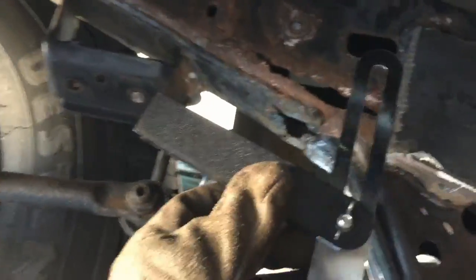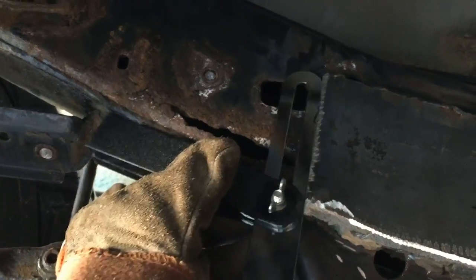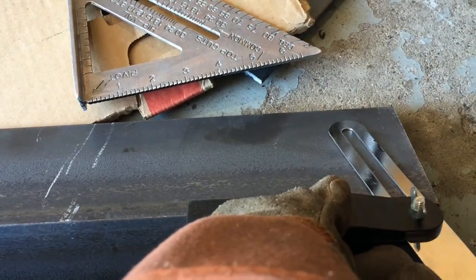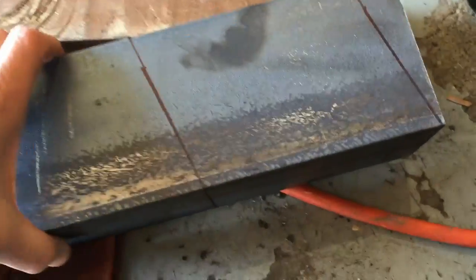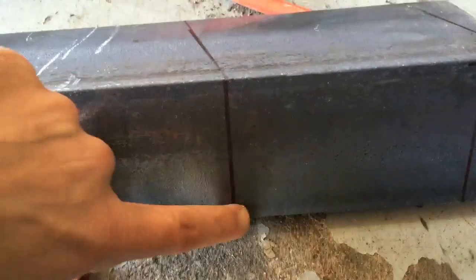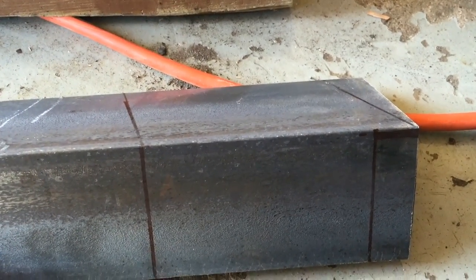Here's a handy little tool that helps me determine the angle. With a little bit of measuring, we ended up with 30-degree angles to cut. Then on the bottom I'm going to do an offset of three-quarters of an inch. That's why it fits in there — it gives me plenty of welding material. This piece is going to actually overlap the bracket that I'm trying to hold on.